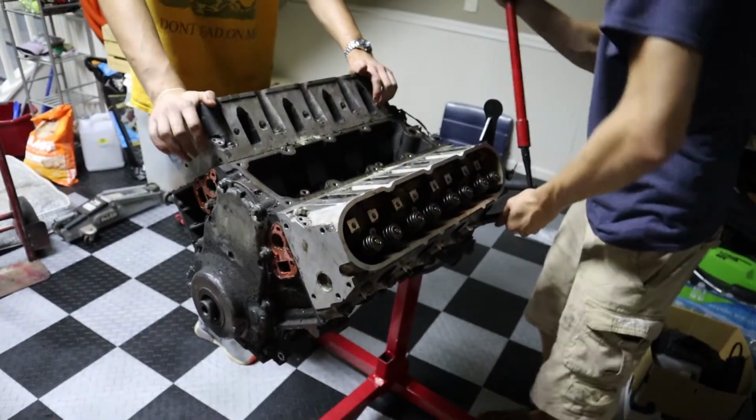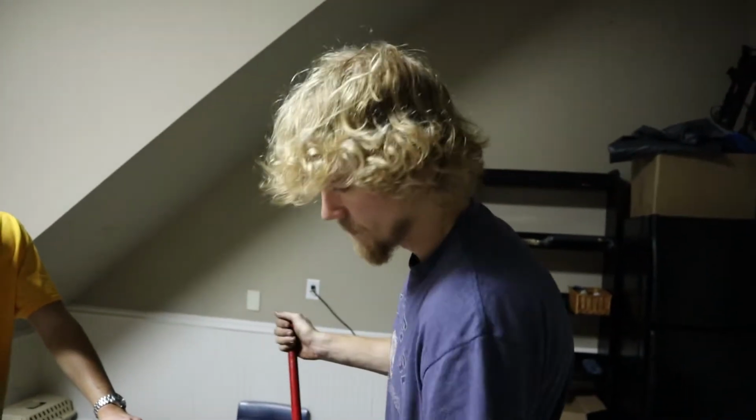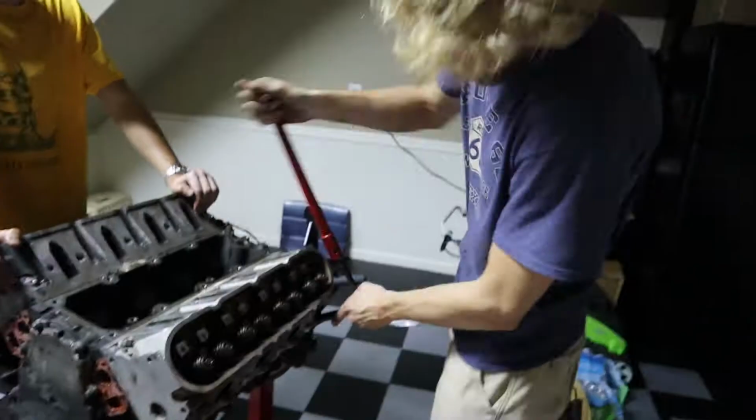One common thing to do at machine shops is what's called deburring the block. It's kind of expensive, but it's kind of worth it if you're using the block multiple times for different builds. They take a Dremel, go along the edge here, and ever so slightly bevel it, so when you're handling the block, it doesn't cut your fingers.